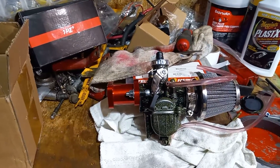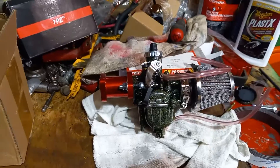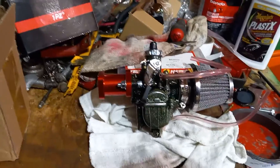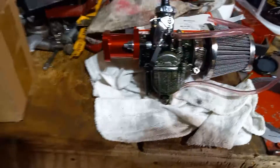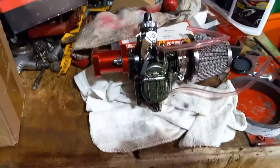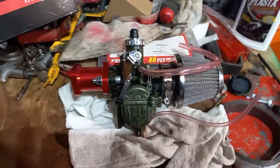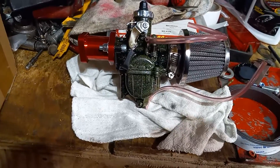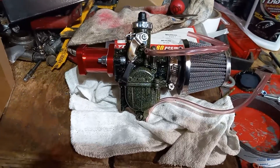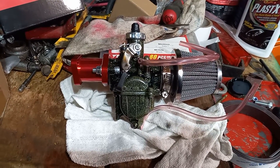There are other things you really need to consider when doing it. I got a good deal on this Mikuni because I've bought quite a few parts. Is it better to spend sixty dollars, shine it up, and put your own touch on it? Absolutely. I mean, I could have gone up to a 32 millimeter but I'd have had to do other modifications. There's no need — I can change the jets, and I've got probably a couple hundred jets in my kit.